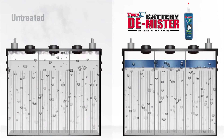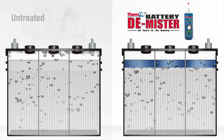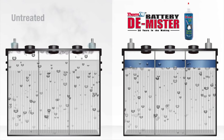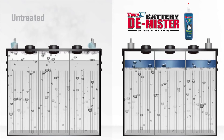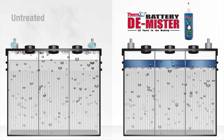As the battery charges, hydrogen and oxygen gas bubbles rise and break violently on the surface of the untreated battery. But on the treated battery, these bubbles have to work their way through the half-inch layer of oil, forcing them to release their gas gently on the surface, stopping all acid and water mist from escaping the vent tube wells. We have inserted a clock with a second hand to remove any doubt that it is in fact a continuous, unedited shot.